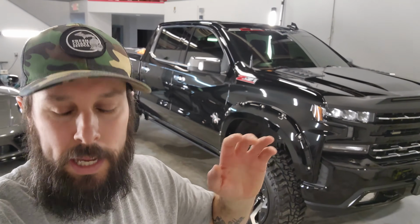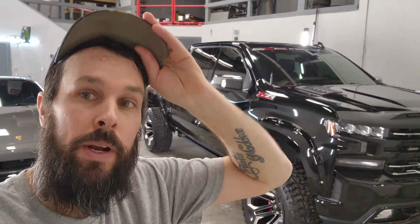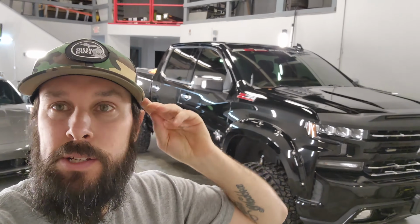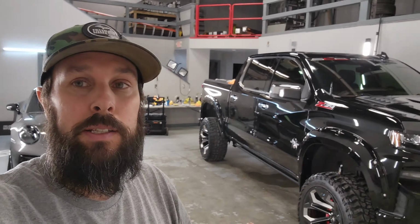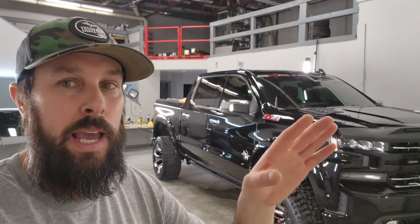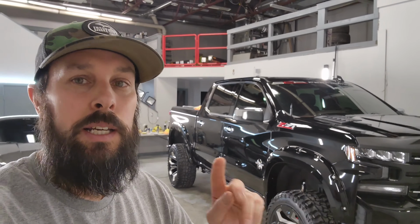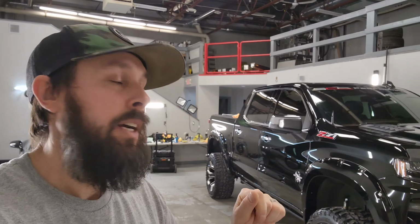All right, guys, one thing you'll notice, I was moving quick. This coating really depends on temperature, humidity, how fast it sets up. Right now it's setting up very fast, almost instantly. So you gotta work real fast, because this is not like a CarPro product or whatever you guys use at home, Chemical Guys, Adams, whatever. If you don't get this coating off, you can't get it off unless you polish it. It sets up very, very hard. And you can't get it off.